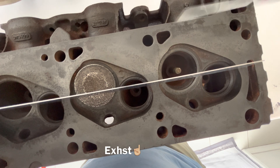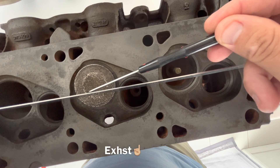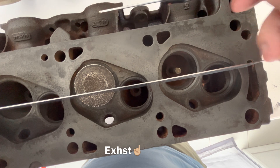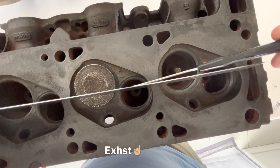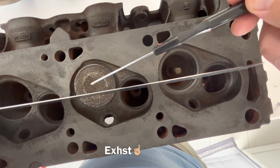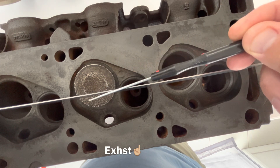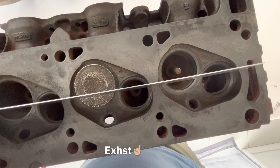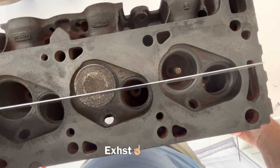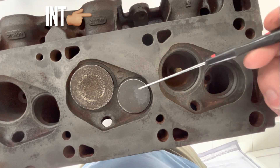If you compare it to other straight-line arrangements where the valves are more over the center of the cylinder and the exhaust valve is next to it, they tend to have a longer travel in the exhaust port and also a longer measurement on the intake port, because the center would be all the way up here. Some heads tend to be a little more torquey because the longer the intake port, it does promote a bit of torque in that aspect.